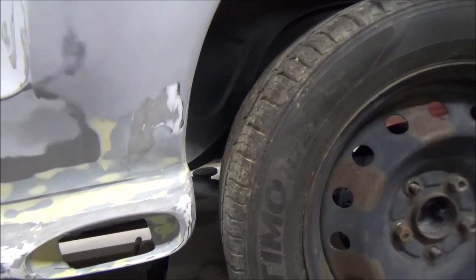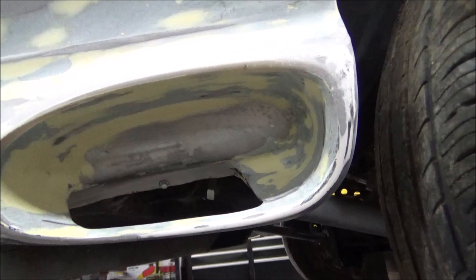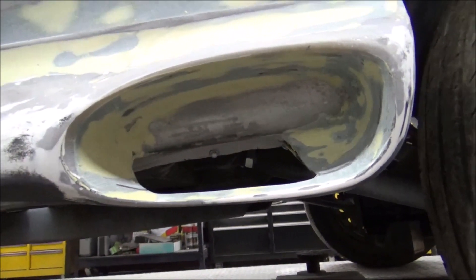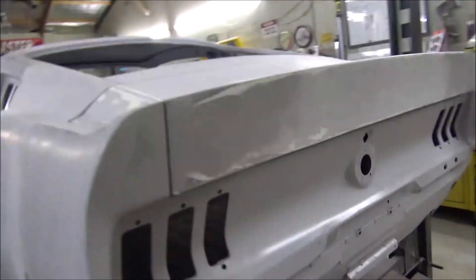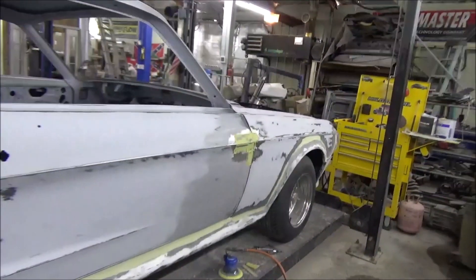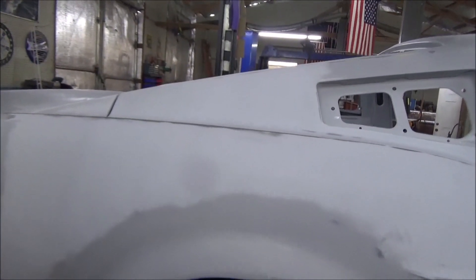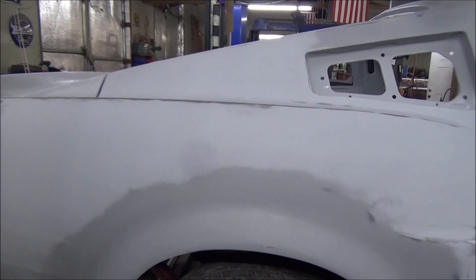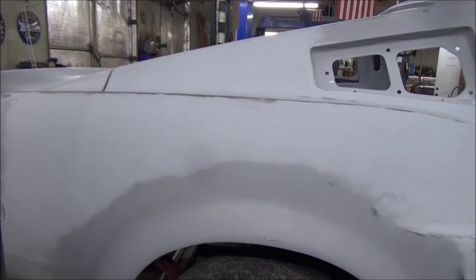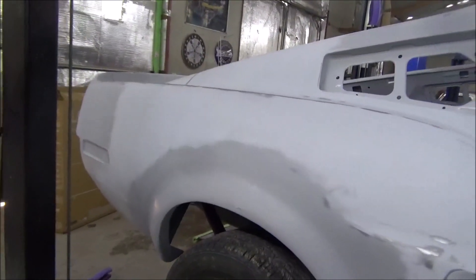I took them side skirts and rounded them in where they look nice - there was some crappy looking hole in there but I've got that taken care of, and we've got both sides done. What I've done next is sanded the whole car back down with 240. Believe it or not, 240 is pretty slick to a point where it's going to get any bad marks, any runs, anything I have with the previous sealer on there - it's going to chill them out.